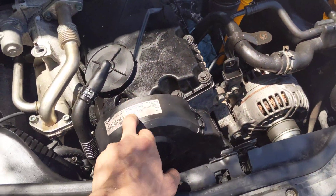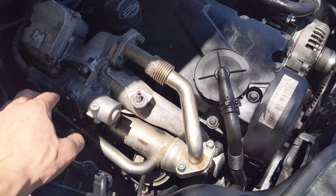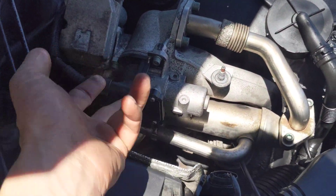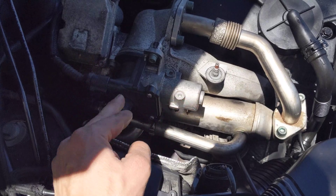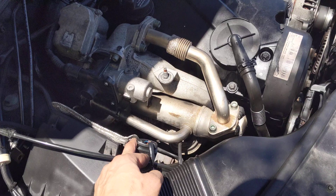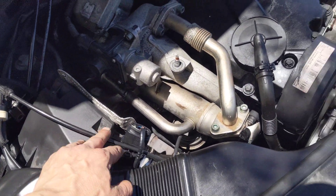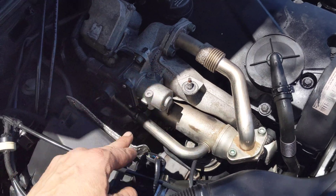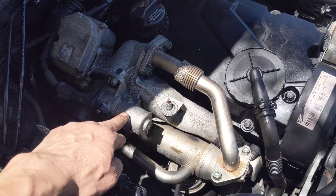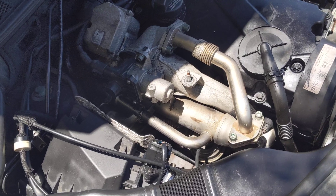Also at some point, check the quality of your timing belt on this car. Here's the EGR valve — this thing comes off with just three Allen bolts. Mine was completely clogged. My air filter was clogged also, which gave me a MAF sensor error. So with a new air filter, I did these things at the same time: a new air filter, cleaned out the EGR, and then the code went away.